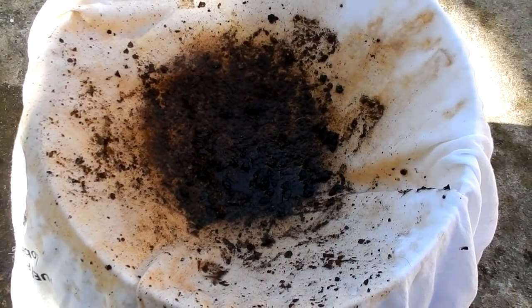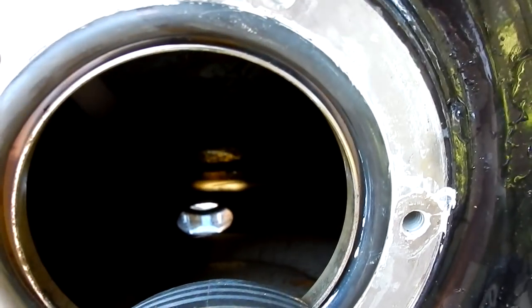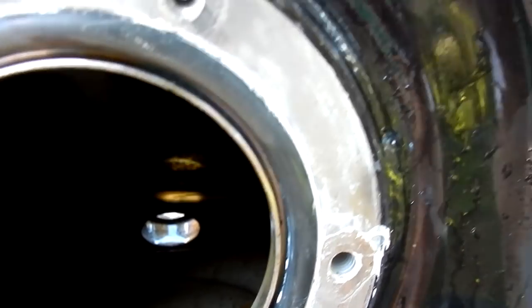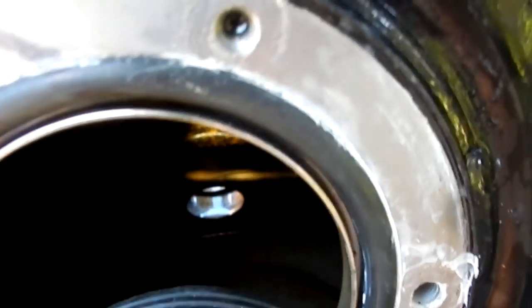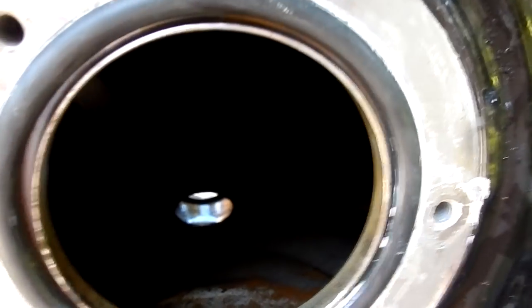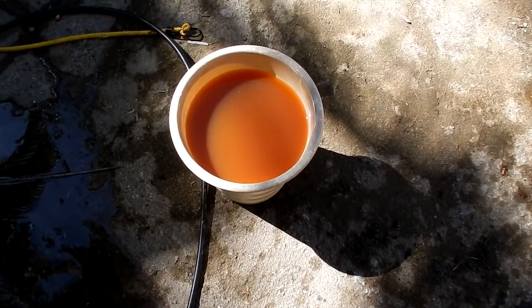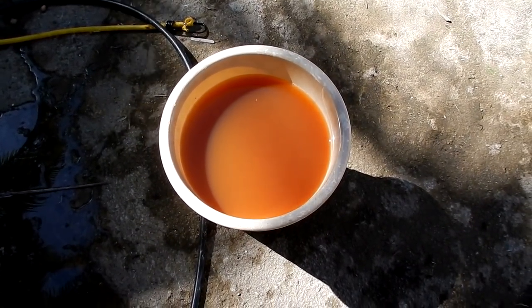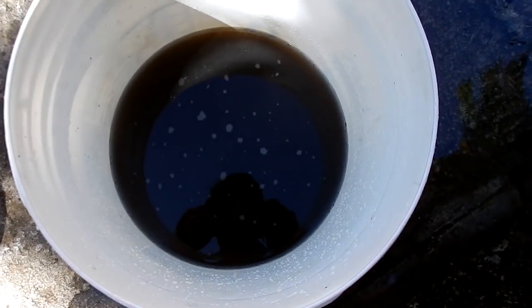That's a whole lot of rust that's been removed. We're going to open the tank up and see what's in there now. There's a whole lot of rust removed — I'm very pleased with the progress so far, but I think it needs a little more time. So I'm going to seal it up and fill it again to make it even more rust-free. The solution I took out was really cloudy, so I'm wondering how well it was conducting electricity. Before we go through the electrolysis process again, we took a pressure washer and blasted the inside of the tank, and this is what came out.